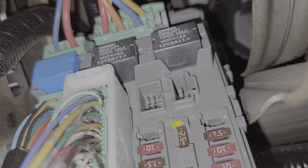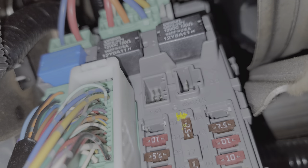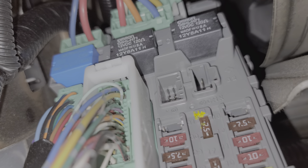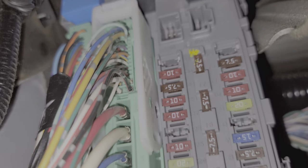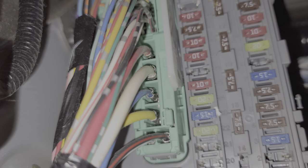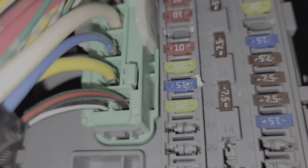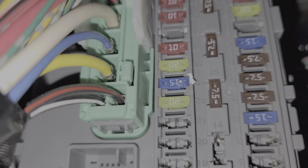The relay is going to be that center relay right in the middle. When that relay engages it sends power to the outlets. Now there's another fuse here, number 23. That is the blue 15 amp fuse that I've got a little white paint next to it. Power from that fuse is sent to the front outlet.